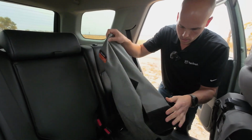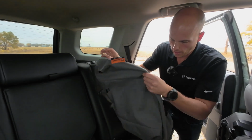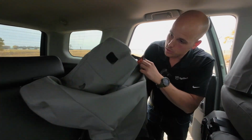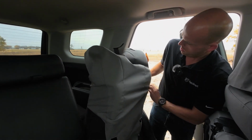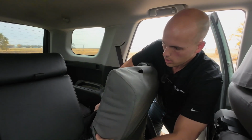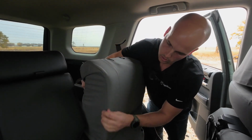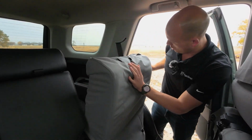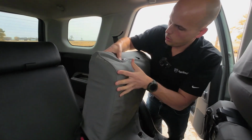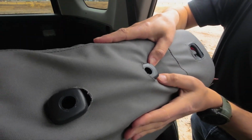This is the seat back cover, also for the driver's side. It's also got the TigerTough tag on it. That must face the door. So I'm just gonna lean that seat back forward and start sliding this cover down. And as I'm pulling it down, just trying to make sure that the seam runs right down the corner, like so.